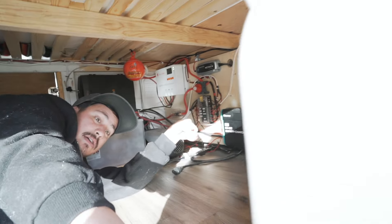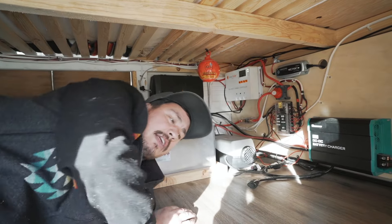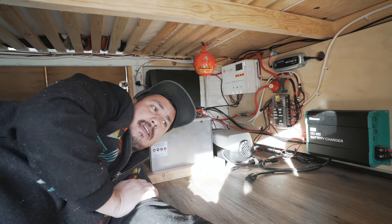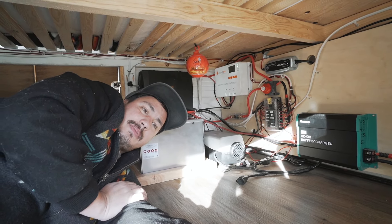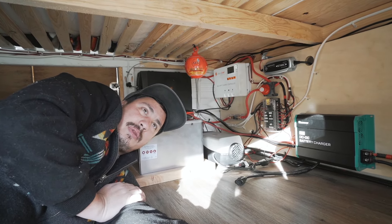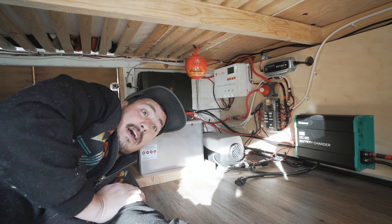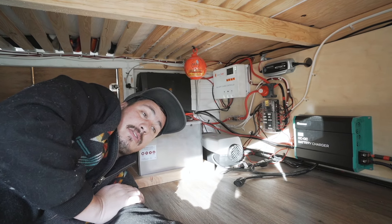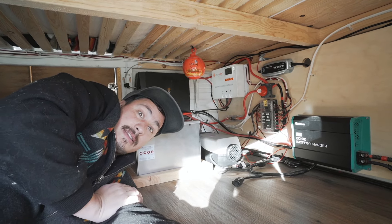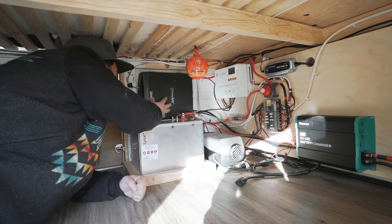This is the heater, and that's the heater tank over here. A lot of people like to tap into the diesel tank, but it's a big job and I like having it separate because I go to really remote places and I really want my fuel in the main tank to get out. So I personally keep the diesel for the heater in a separate tank. Over here we have our Grape Solar 1800-watt inverter — they sponsored that as well.